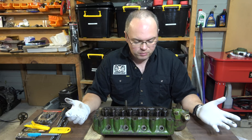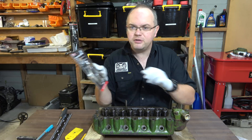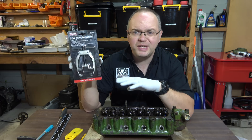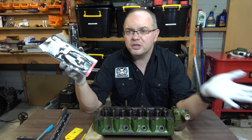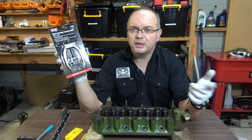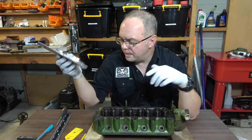So what tools do we need for this? We've got a few scrapers, we've got our valve spring compressor. This is a Toledo valve spring compressor - it's not your standard kind of big lever one, it's a slightly different design. I thought I'd go with this one just to show you something different. It's a Morris Minor, hardly rocket science, so this one should do. Advantage of ones like this - you can use them with a head in the vehicle.